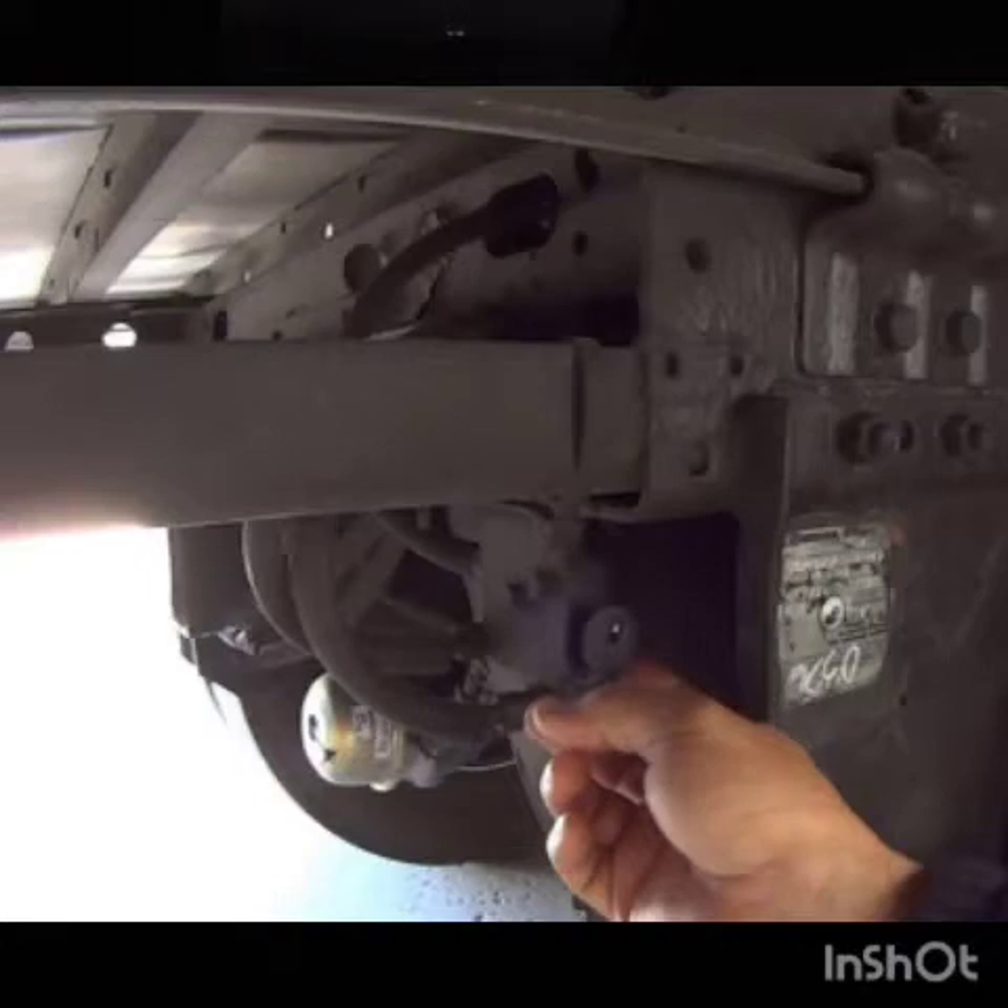That's going to allow you to slide your trailer tandems. A situation like this usually happens where you can't slide your tandems using that air valve system because the forklift is so heavy when you're getting loaded or unloaded that it pushes all the air out of the tanks.